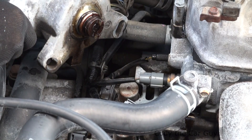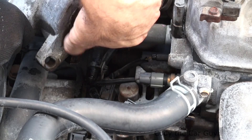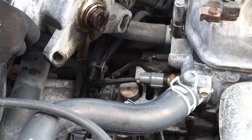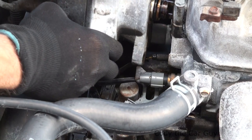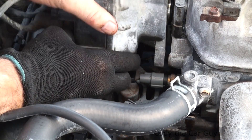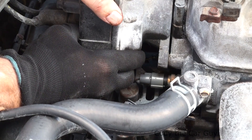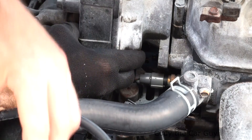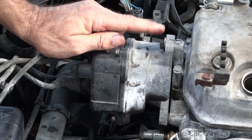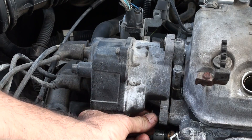Just putting your new O-ring on it is just that simple and easy. Make sure you get a little oil around it, and all you're going to do is slide it right back up in the groove. Match your line back where you had it. Once you wiggle it into place, put your bolt right here in, snug it up a little bit, and then go ahead and put your bolts back in.